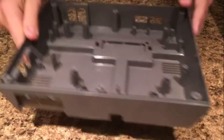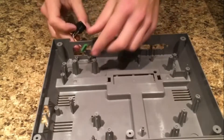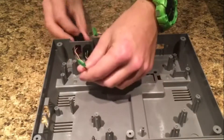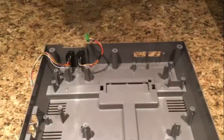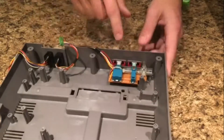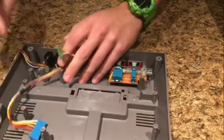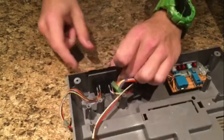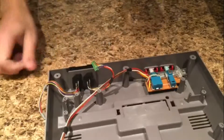Now we're going to put it back together. Start with the base and put the general electronics in. Find your controller port with the shorter wire — that goes in the player one slot. Just feed it back through; it won't lock in place but it'll go in. Now put controller port number two in the right spot — make sure it's not upside down. Take the cover piece; it'll kind of hold itself in place once you wedge it in. Remember there were two screws holding that in place, so screw that back in. Also take the controller port cover — to put it back on, line the top up first and then bring it in at the bottom. Then put the two different screws in for the bottom of that.